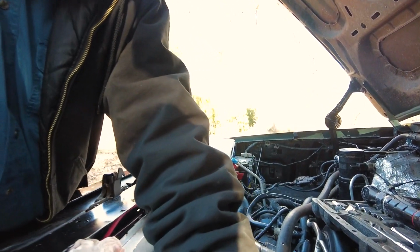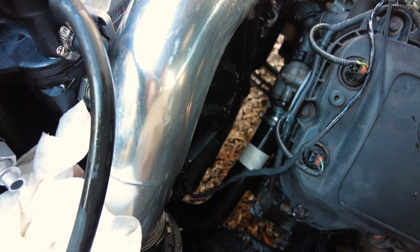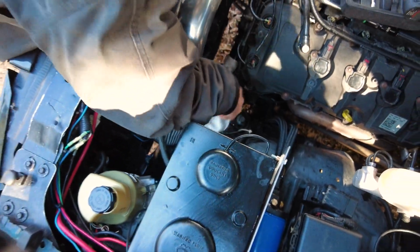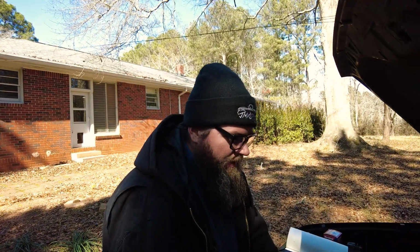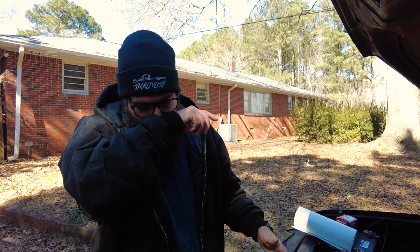The bottom hose is like 50. Yeah, so it's obviously not circulating water through the radiator for some reason. Right. So it's either the thermostat, or it's the pump, or it's a giant air bubble, right? Right, and Gumby says a lot of times, because they are metal impellers, the bearing will go bad on the impeller. And so the impeller will be spinning, but the bearing's just spinning. It's slipping. Yep. So we do that still.